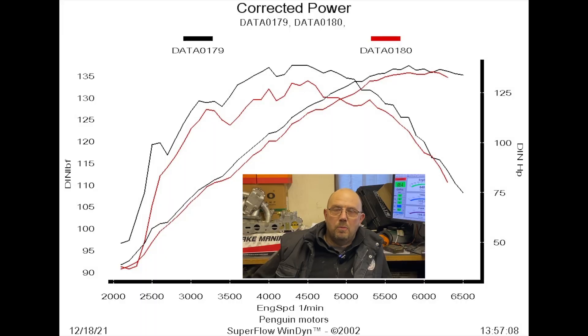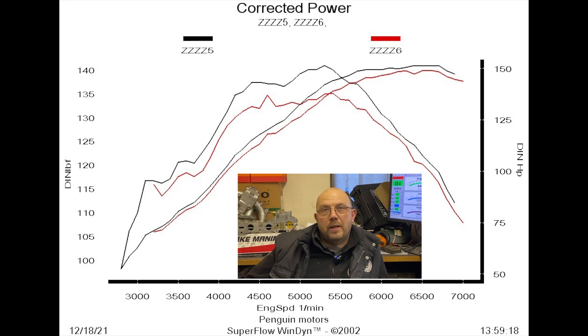First up we've got the small bore Ashley against big bore three-piece on the 285 cam. Point to note here that the three-piece manifold was a bugger to jet but I got there in the end. And now we have the second power output, which was the 152 horsepower on the small bore with the oval racing F2 cam against the three-piece.